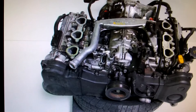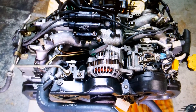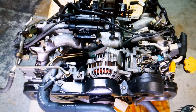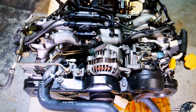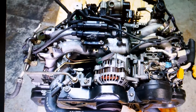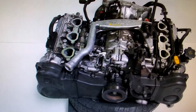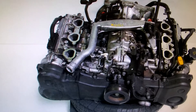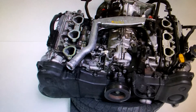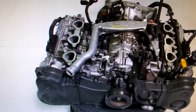As far as locating the engine, wiring harness, and different things such as that, these can be found on eBay, Craigslist, or you could go to a salvage yard. When you go to a salvage yard to find an engine, you definitely want to get that engine out of a car that maybe has rear end damage. You don't want one with front end damage because you don't know what condition that engine will be in. Also, check what the warranty is on the engine. To my knowledge, the majority of these garages are not going to find the engine, the wiring harness, or the engine brain for you — you're going to have to find these things yourself.